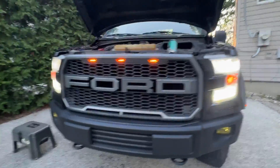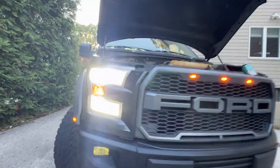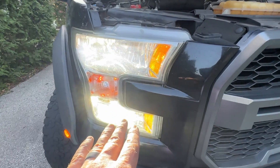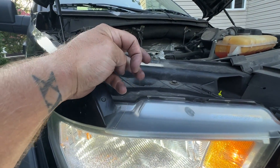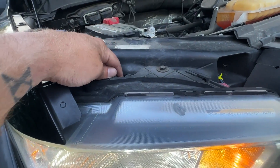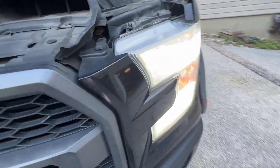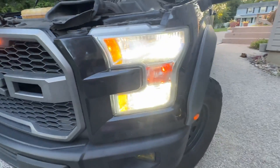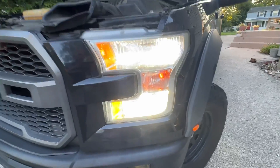Both are installed. Nice bright white. My initial review: they're nice, super bright, super white, and seem to be quality. The bottom dust boot fits fine for the high beam. The upper dust boot — the back of the light is too close to the housing so you can't put the dust boot on completely; it's only a small gap at the very top. Keep that in mind when purchasing — I think that's common with LEDs. I have Anzo headlights so there's more room and the LED fit inside with the dust cap on.